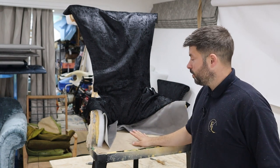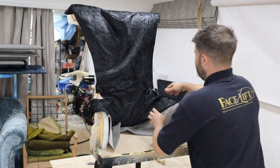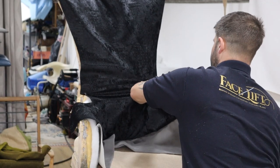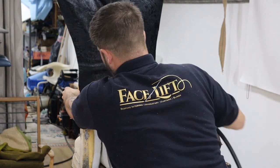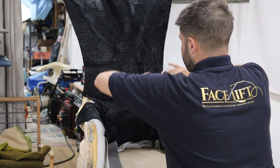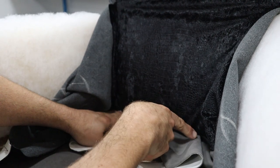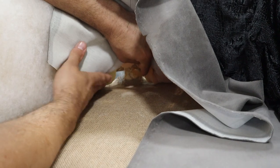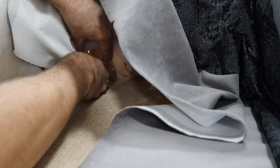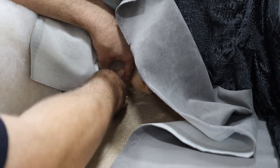You've got to get the back on first before you put the foam for the seat on. It's all sewn up — we've got a fly on the bottom and our two collars on the side. I'm going to staple them in the same position to temp them down. Now we need to make two cuts — there's a rail here and a rail over here. Lift the fabric and foam and you can see that rail. We want to cut up to that rail and then, when you get there, cut in a Y-shape — straight and then that way and then that way.